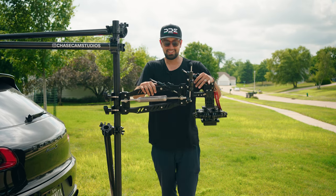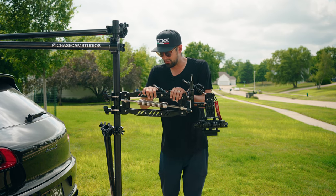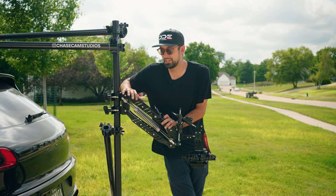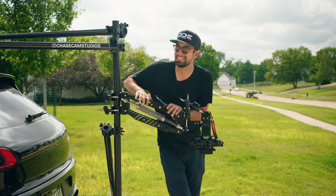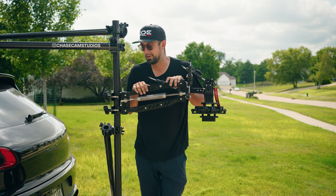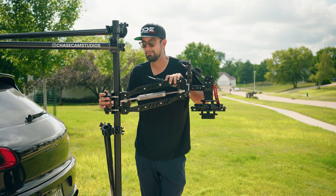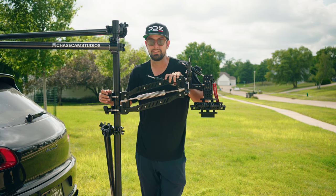So when it sits like this and you mount your gimbal and your camera, the one thing to consider is, when it goes all the way down, how high is your camera off the ground? Because the last thing you want to do is mount this and not consider that, and then you hit a big bump and this arm compresses all the way down and your camera or gimbal takes an impact to the road. And so you can see I've only barely hand tightened this and it is already very secure. I will really knuckle it down and then we will go ahead and install the gimbal.